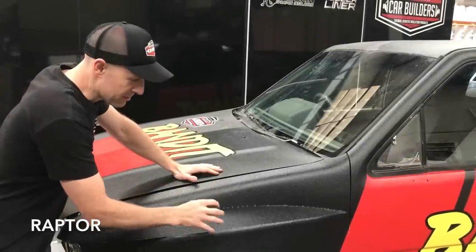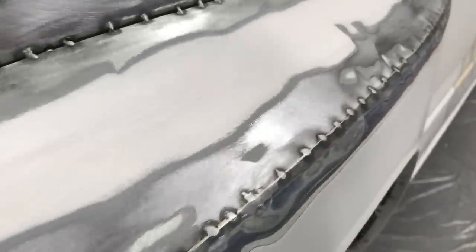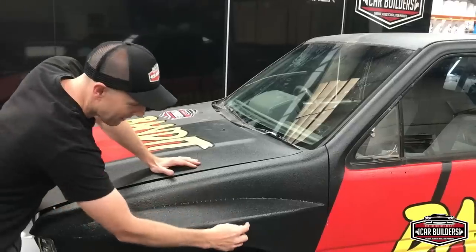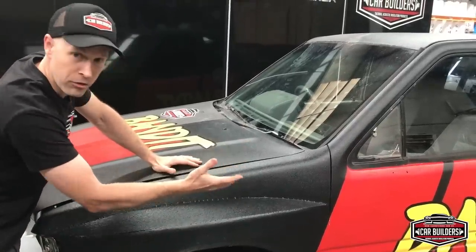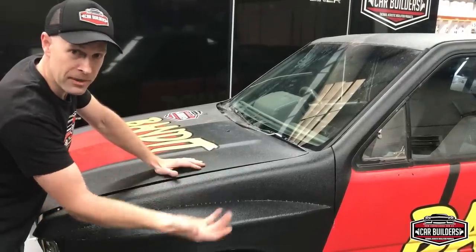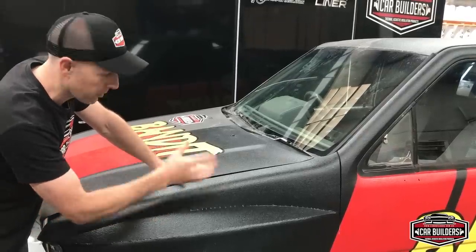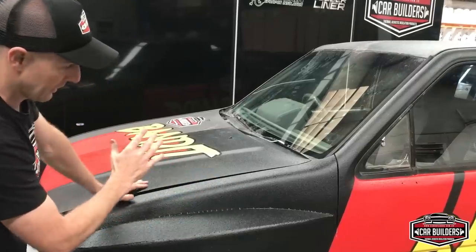Looking at the Raptor side, we had a whole range of finishes — from top coat paint sanded through to a multi-layer wedding cake, through to bare steel, and we left this raw with the spot welds. These paints are really forgiving — we can hardly even see the spot welds. There's no onion ring or shadow from the different layers, which you'd typically see if you tried to finish this in a standard exterior paint — two-pack, acrylic, or enamel. For a vehicle that's had a lot of work done and is pretty rough, it actually looks really good.